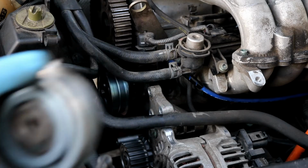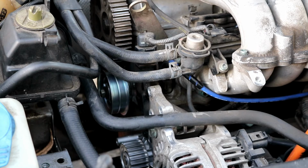So go on ahead and stick that on there and just hand tighten this nut and washer that's there. And then when you stick the timing belt on, you want to start at the crank at the bottom and engage the belt onto the crank. Do not spin the crank around, because you got to keep your timing marks. Then from there, take it up to the water pump and then on top of the cam gear, and then you can route it around the tensioner.